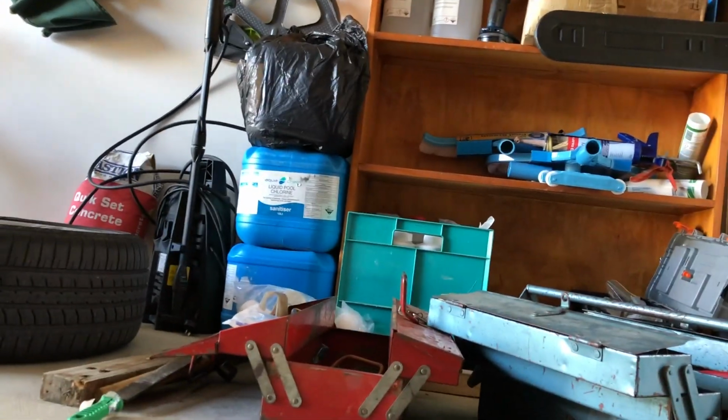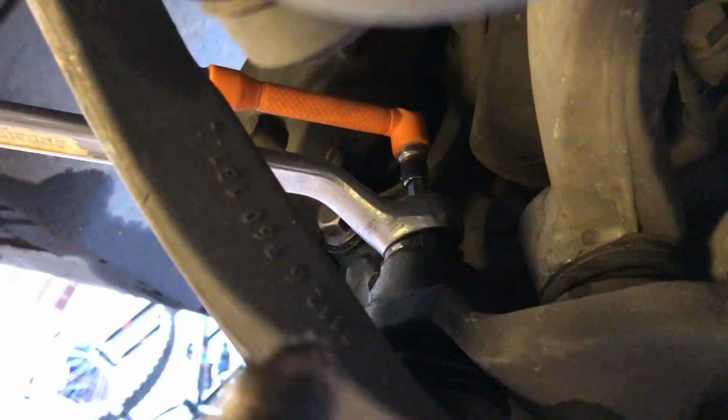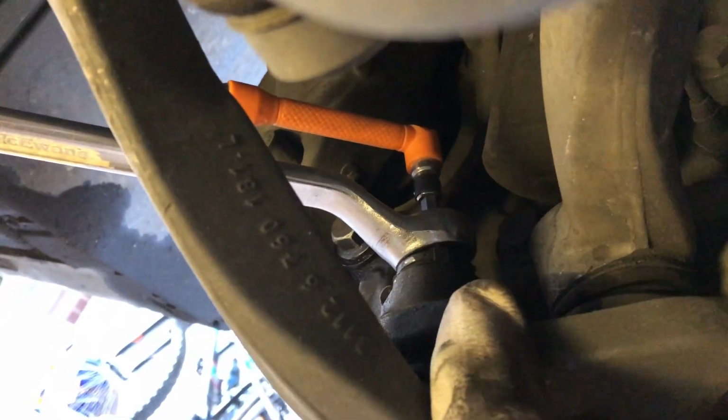This is the front control arm here, undoing the top bolt here. I use my big breaker bar that I use on my socket here. I'm not using the ratchet head, but using my big breaker bar, and I was just able to jolt that off. When you pull it gently, the wheel turns and you can't actually undo it, so I was just able to boom, boom, boom, jolt it, and get that off. Because this is a ball joint, it's free to spin on that little shaft of the bolt you're undoing. So the socket was just spinning the ball joint where it was.